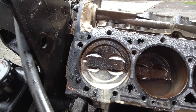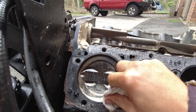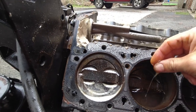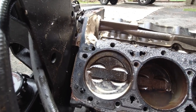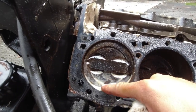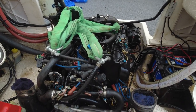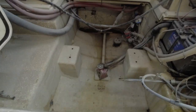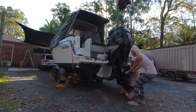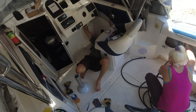So we wanted to order an outboard as soon as we possibly could, because I knew this was going to take a lot of time. One of the most common problems on an inboard motor is that the risers and the exhaust manifold can corrode or block up, which either lets water back into the engine or blocks it up and causes it to overheat — but the seller said he'd already changed these not too far in the past. Stick with us through this arduous journey if you want to see the amazing transformation from inboard to outboard and how it's done — and it's definitely not as simple as it sounds.